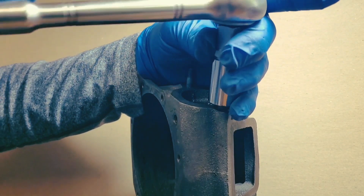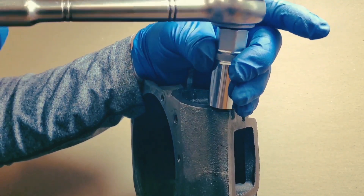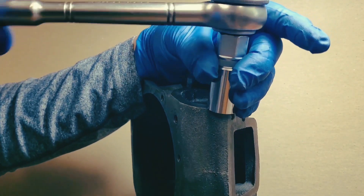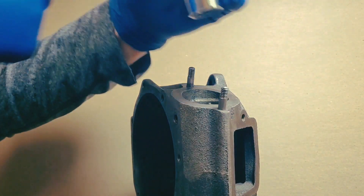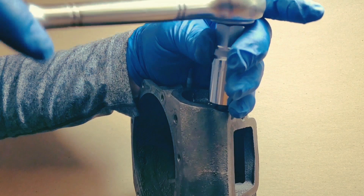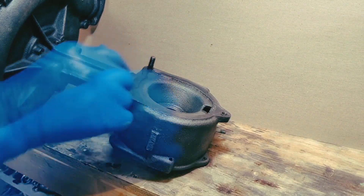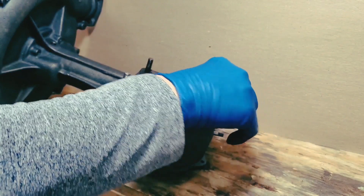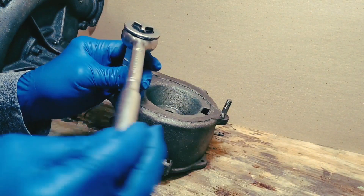Some people even decide that they've got something that fits if they make the hole larger. I also see many broken-off studs and broken-off bolts that we have to extract — lots of helicoil work, normally. We found the correct parts from our spare superchargers for Chester's and have been putting them in. Sometimes we can source hardware parts, but for these specialized Graham pieces, we have to have spare superchargers just for those.